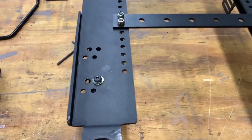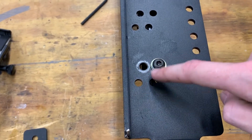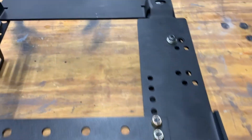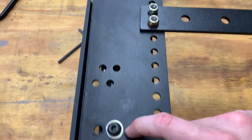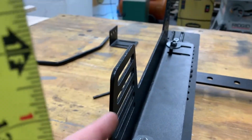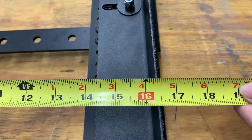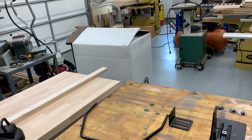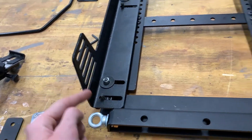Let me show the underside. This slider was mounted here — this is the widest and the narrowest setting, and these two were in between. So it was second from the widest, and now it's the narrowest all the way around. I bolted this down tight so there's no false numbers from wiggling. I'll call that 16 and a half inches and call the seat 15 and a half — so that's an inch I need to go in, meaning I'll drill half an inch on each side.